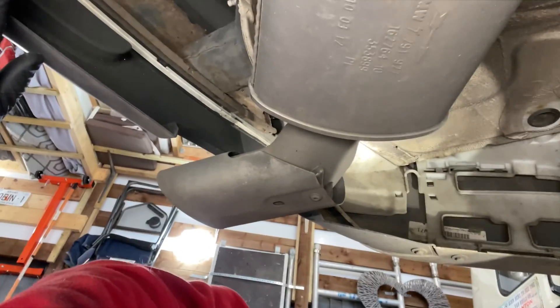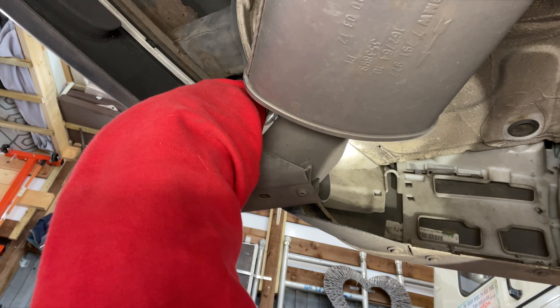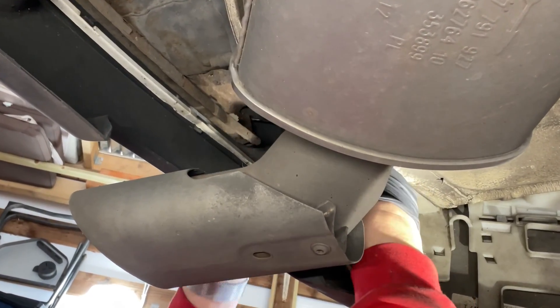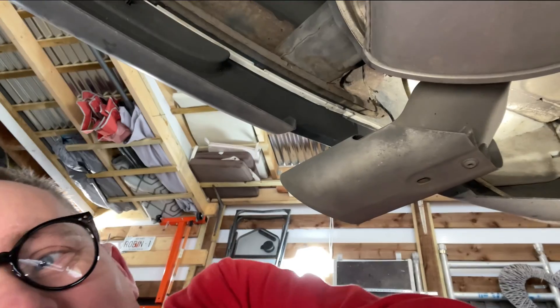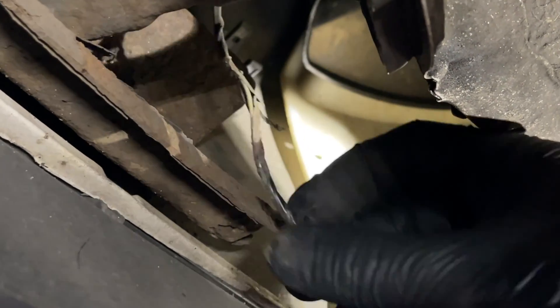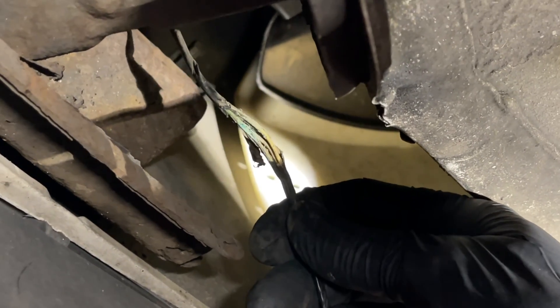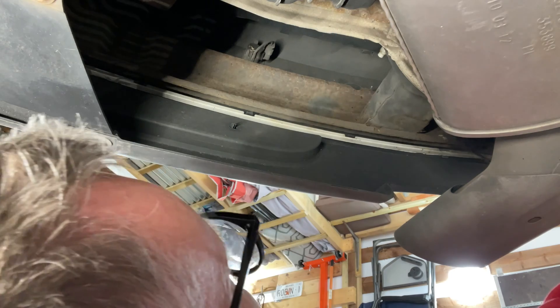This wire is trapped behind the bumper — can you see up there? It's kind of got rubbed behind there. Oh, it has — I think that's what it is. It's been rubbing on the back of the actual bumper because it's behind the beam. Oh yeah, I think it's got trapped. There it is — we've got it. It was just trapped behind the beam and it's damaged the wiring. If I turn it around you can actually see it's rubbed right through that wire. That makes sense when it said PDC lines — the lines are the wires, because it's translated in. We've lost a little bit in translation, but PDC lines means the wires.